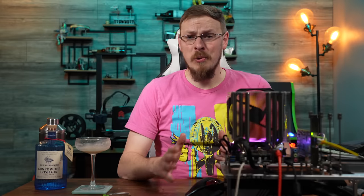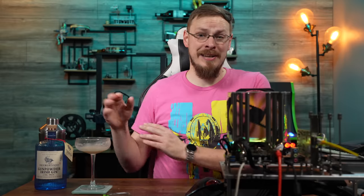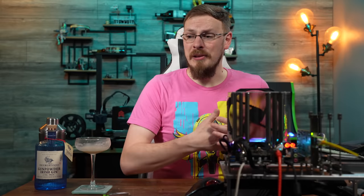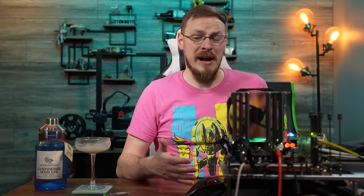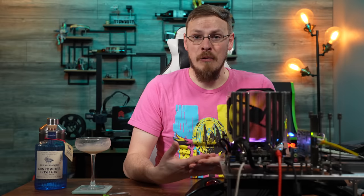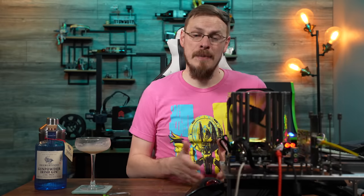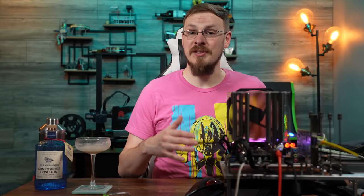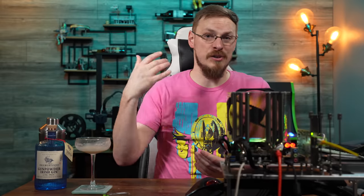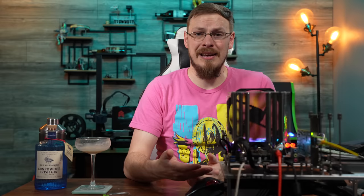So what are the real world implications and uses of 100 gig networking? Obviously, my office notwithstanding, as it's anything but real world in here sometimes. For big data, for large hypervisors, for cloud scale providers, 100, even 200 and 400 gig networking is used for storage area networks or interconnect between multiple clusters of servers. This means low latency, high bandwidth access for multiple simultaneous connections at once. Or for something like web servers, where you're Google and you need to possibly serve a billion hosts at a time. That's definitely a use case for a pipe like this.